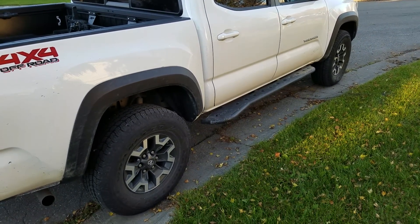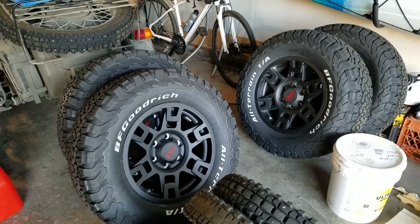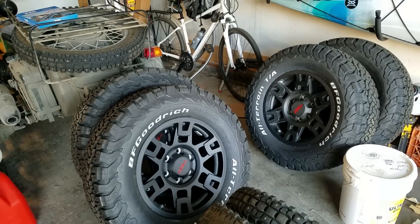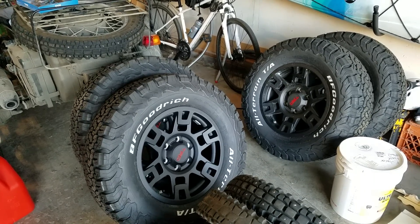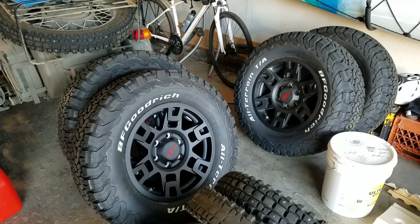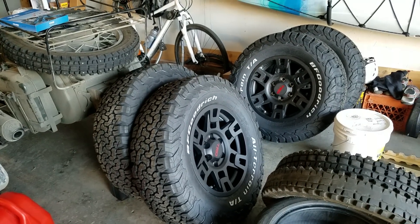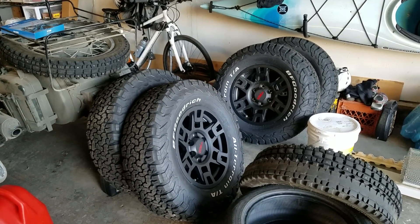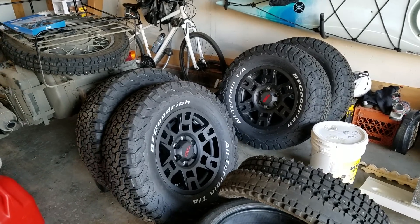I do have another wheelset. The other wheelset I have is some TRD Pro 17-inch rims — these are from the 4Runner platform, not specific to the Tacoma. There's an extra couple of millimeters of offset. I'm not looking to do rock climbing or heavy off-roading; I just wanted something with a meatier tread that looked a little bit better. This only gives me about another inch of tire diameter, so maybe another half-inch of ground clearance, which is fine. I mainly want it for snow clearance, and half an inch more is just fine for me. Maybe after the warranty's up I'll play with it more, but for now I think those will look really good on the truck.